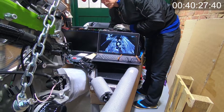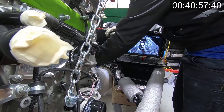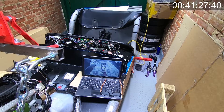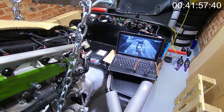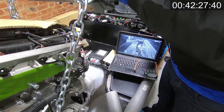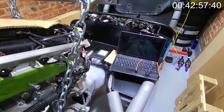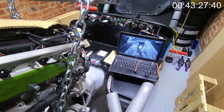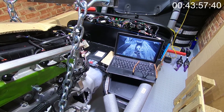Around this time I was almost convinced the engine wasn't going to clear the top chassis rails. It took a process of elimination — can the engine be pushed further into the tunnel? Does it need to be leveled out? Can it clear the chassis rails so I can lower it more? In the end, the solution was to make smaller adjustments and keep repeating them: ratchet in a little bit, level the engine out, lower it a small amount, ratchet in again. Until I realized the cardboard protecting the footwells was preventing the gearbox going further into the tunnel, as there are two vertical chassis rails in the throat to the tunnel which provide just enough space for the width of the gearbox. So the cardboard had to be removed.